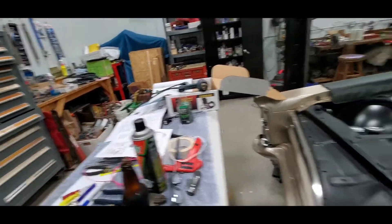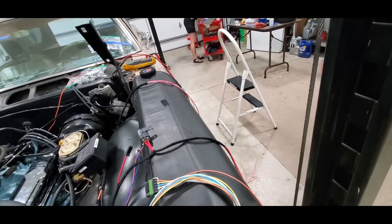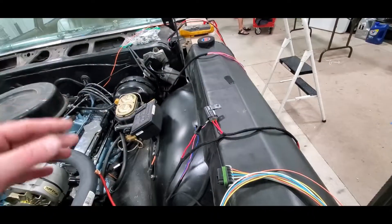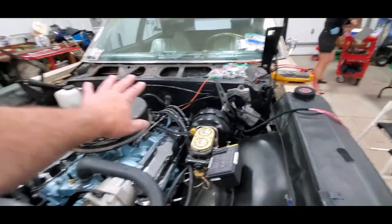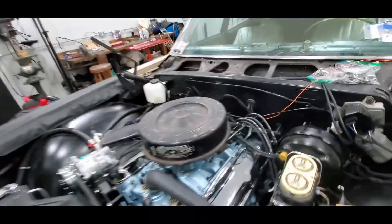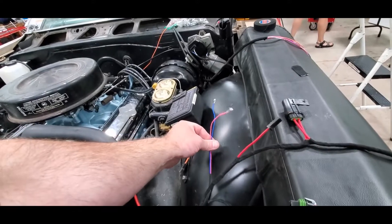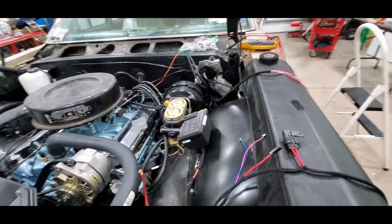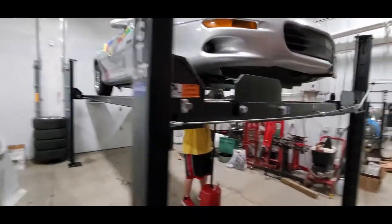This is the switched ignition feed — this skinny wire here — and I'm getting ready to depin this because it will follow the same routing since the connectors are right next to each other, so they're going to get loomed together. Then the two switched lines for the fans are just going to follow this — they'll be separate but they'll follow it. I've just got this taped up further. I'm going to run it under where I plan to run it because the connectors are way back there, and get it all trimmed out. Once it's all cut then I know where I can harness it — I don't want things too short, I do want a little service loop, but not too long either.